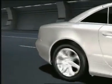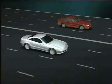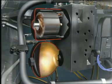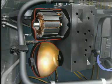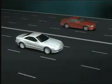SBC has three main advantages: a fast build-up of brake pressure, optimum brake power distribution, and the absence of any noticeable pedal back action with controlled ABS braking. In cases of emergency braking, SBC achieves distinctly shorter stopping distances. Unlike conventional brake systems, SBC can supply the desired pressure and the required volume to the brake calipers from the high-pressure reservoir in the shortest possible times for faster brake pressure build-up.